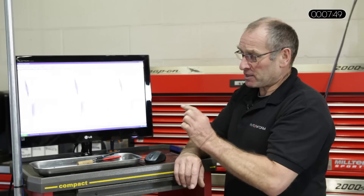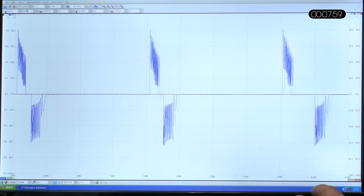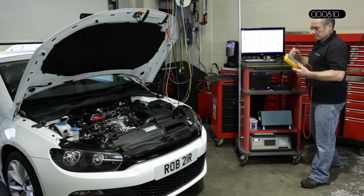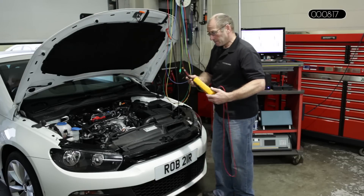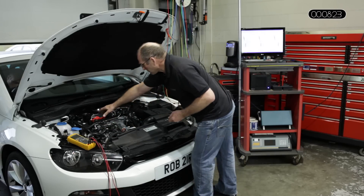That's as far as we can go with a functional engine. Current is the way to go — we don't measure voltage; current is really the effect of around 120 volts being fired at the injector by a capacitor. But if current isn't present because there is an injector fault, the engine will be prevented from running by all power stages closing down. So the next stage is to turn the engine off and show you how to do this simple test with a multimeter. I'm going to wait a few seconds until the PCM powers down completely — simply to avoid installing a DTC. We can remove the clamp. Bear in mind when you use the current clamp, it goes around one circuit only, and the orientation or polarity should ensure that the positive current cycle comes first.